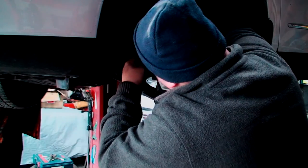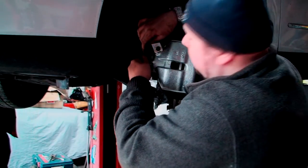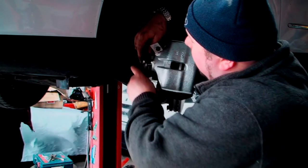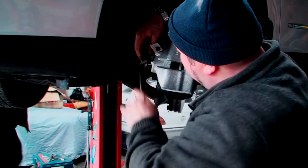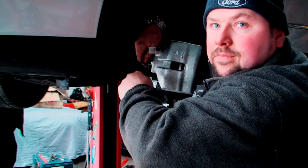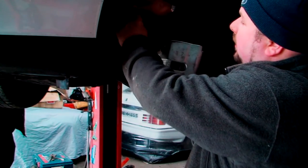And like I said, you just have to be careful in tightening it because it's only a banjo bolt and it can break really easy. But obviously you need it tight enough not to leak, but not too tight where it snaps. Now, that's it. So now what I'm going to need to do is obviously release this,